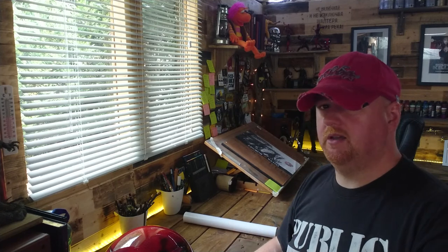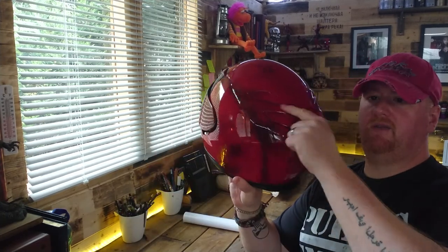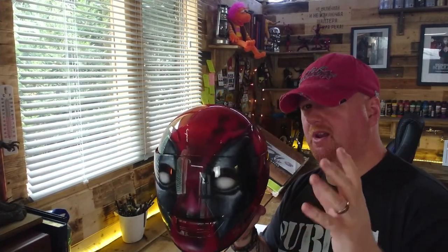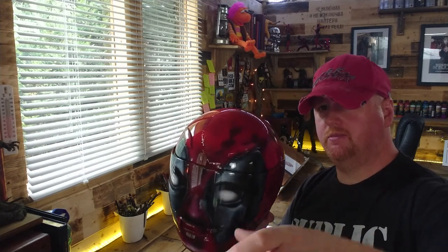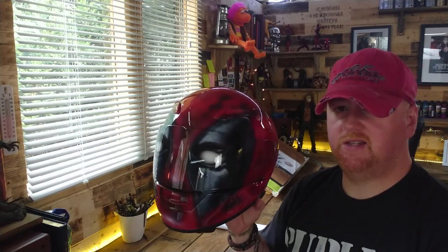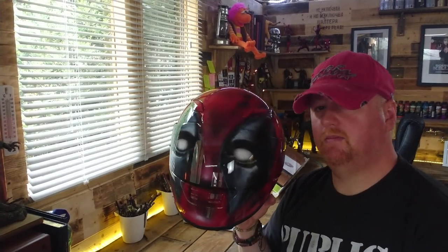The major one is the lacquer getting into the filling. The lacquer on this helmet is a 2K lacquer, just like you would put on your car or bike tanks — any sort of automotive items. What can happen with a helmet is that unless it is completely sealed — I'm talking the air vents here — if any of that lacquer, when you're spraying it, seeps into the filling inside the helmet, it will actually dissolve the filling. There is a video online where someone pours 2K clear into a cup and onto the filling, and you actually see it dissolve right in front of your eyes. The reaction is very, very quick. Ultimately you won't see it happen when you're doing the helmet, but it will be happening inside. If someone whose helmet you've painted has that problem and they have an accident, you've compromised the integrity of the helmet and potentially their safety as well.